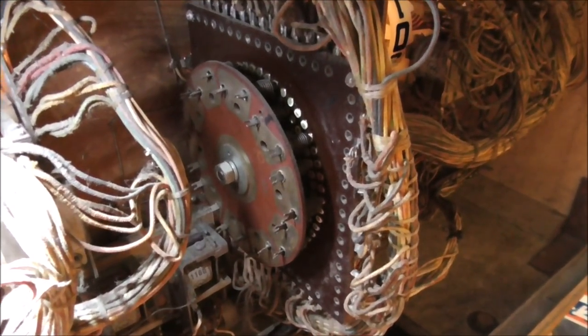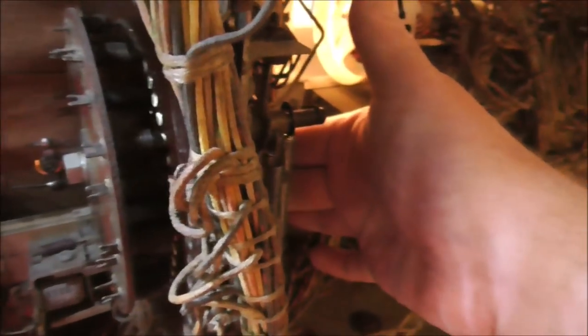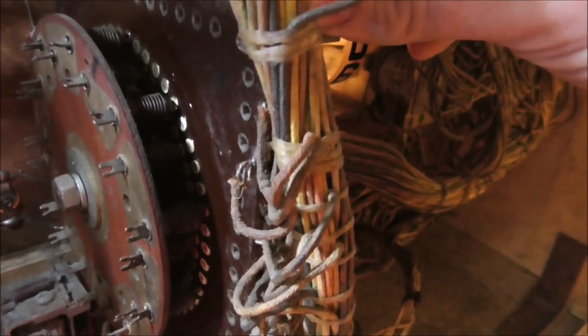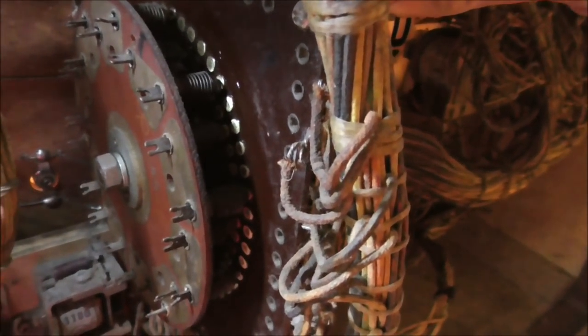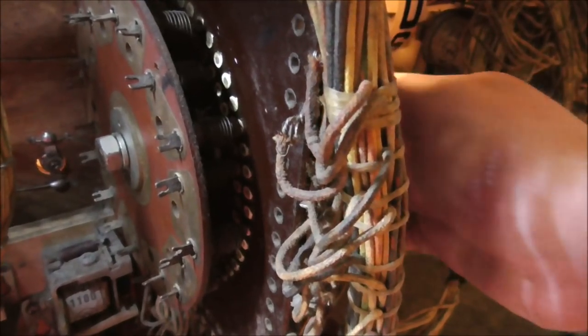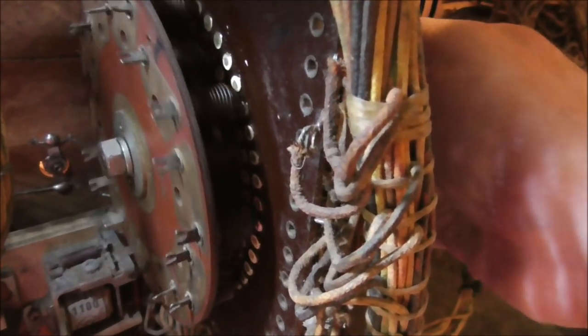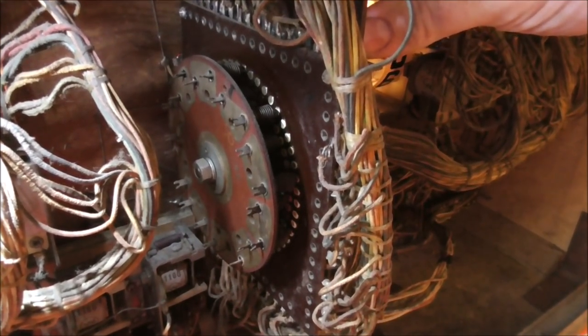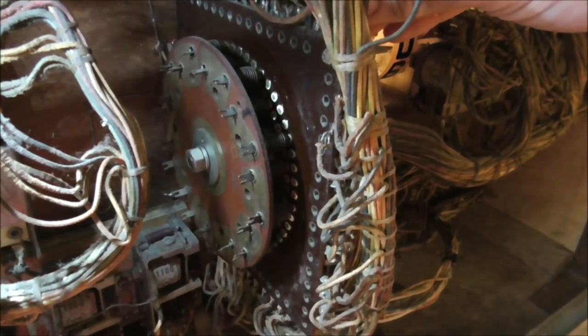Okay, folks, so in the back box, this is the player unit. We are on player two right now. So the way it works is, there's a reset coil and a step-up coil. There are four positions. That's the fourth player. And then this reset coil comes in, and watch, it's going to go back four positions. So that's player one, player two, player three, player four. I'm doing it too slow. When you reset it, it goes back four positions.